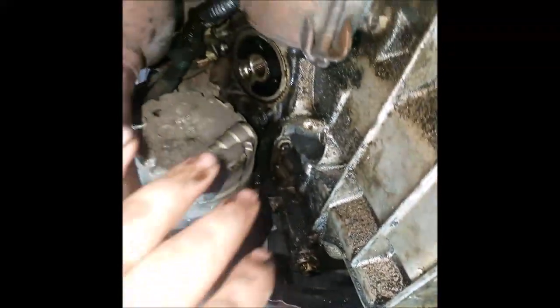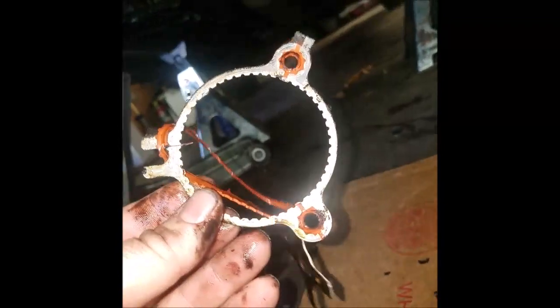As you can see, the gasket is still up there — it just fell apart as I pulled it down. The gasket itself fell apart, but you can see the gasket's got a slot here too, so you can just slide it back in there without taking the AC compressor off. This is definitely worn out. Normally in the middle here there's a rubber seal and that's just gone. The new gasket has a rubber seal around the middle here. This thing has seen better days — that's where the oil leak was.